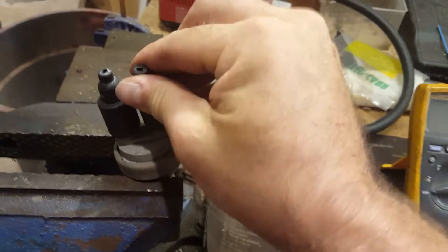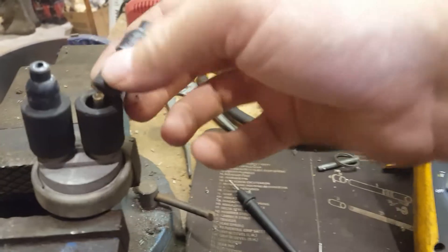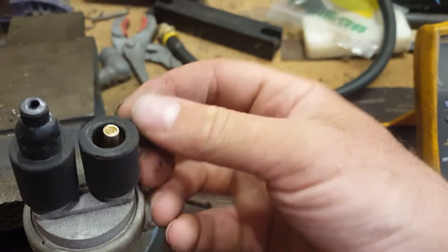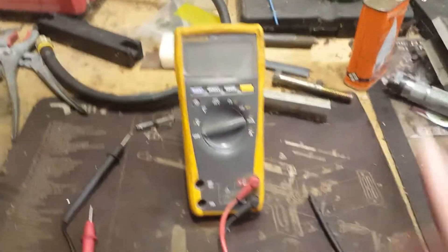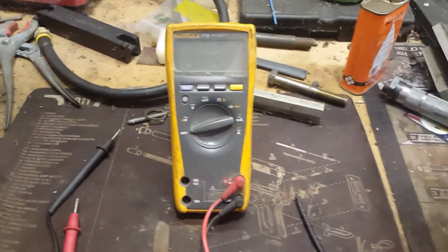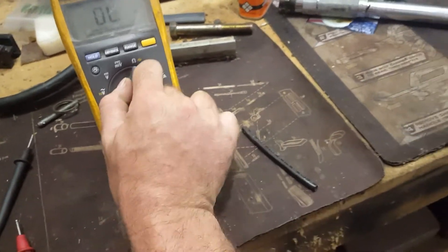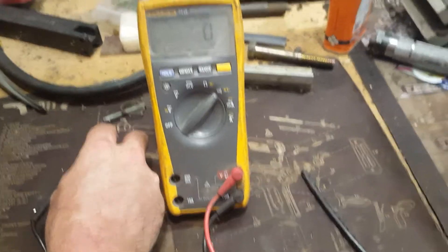What I've got here is my used brake switch and some brand new Packard connectors. I put the brand new connector together and stuck it in there just to give my multimeter something to grab, since I'm doing this alone. What you want to do is take a multimeter — I'd say a quality meter, but really you can use a cheap meter and achieve the same results as long as it works. Set it to the diode test or continuity tester, and touch your leads together to make sure it works.